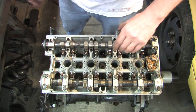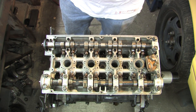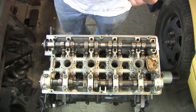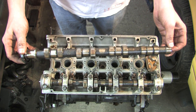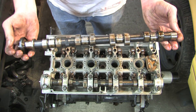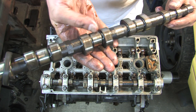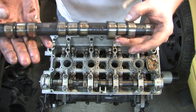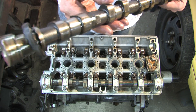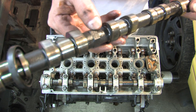If the journals are damaged you will need the cam caps shaved and the bores line honed. You may even need the cams ground if it lowers their center line in the head, so that you don't bind up lifters or break rockers after you put it back together. There is the camshaft — it comes right out. You want to lift straight up on it when you take it out. The journals look pretty decent, got a little bit of scratching, but it is the HKS — they mark the cam size on the hex.